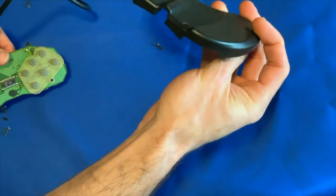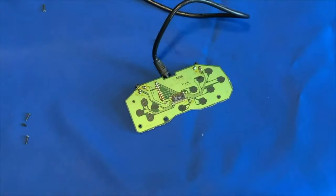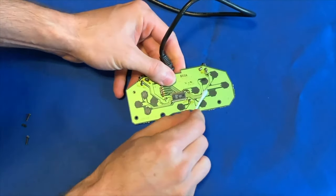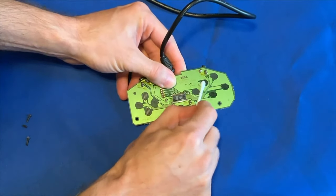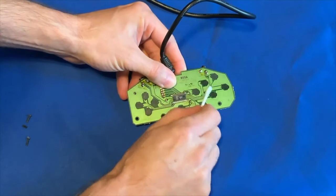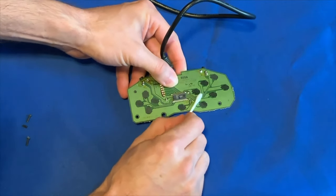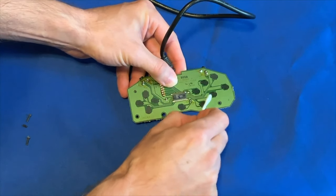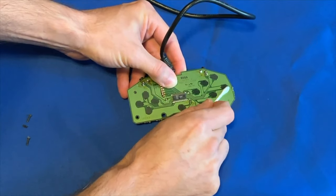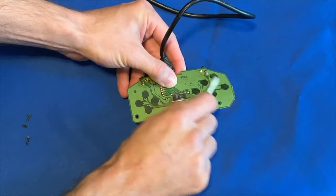The front of the controller is headed to the sink. Into the isopropyl go some Q-tips — just going to give this thing a scrub on the contact points here. These things just need a little bit of cleaning done to them, just clean the funk off of them. Depending on how much pizza and beer and soda previous owners consumed while they played Virtua Fighter, these things might be pretty darn dirty.